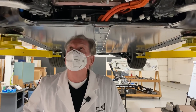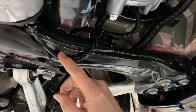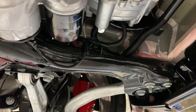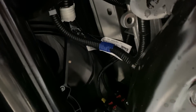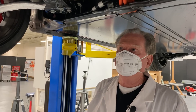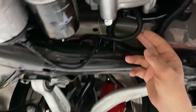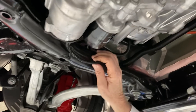Number one: swing in here and have a look at the low voltage wires. Now this might not look like much to the average person, but this is just never done. This is called corrugated wrap. This is put over the top of the low voltage 12-volt wires so that it doesn't abrade, doesn't get scratched and short out. Tesla has gone overboard because we've never seen anybody do this ever. Sometimes we'll see candy striping, which is just basically tape wrapped around it. Sometimes we'll see small sections of tube here and there, but we never see anything that looks quite like this. This has really done a fine job as far as quality is concerned. This is never going to see a short.